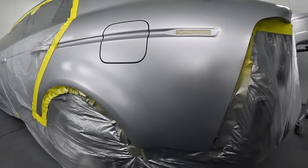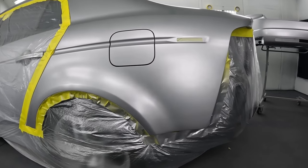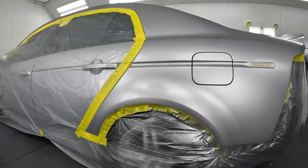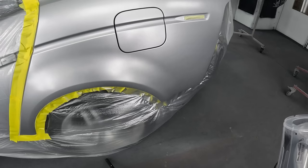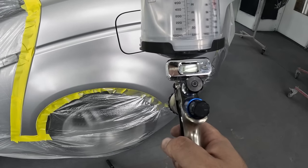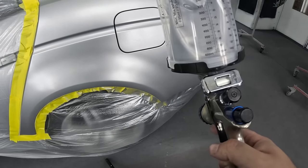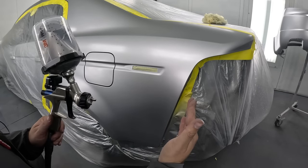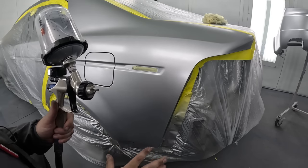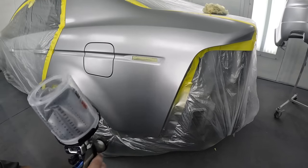Now, looking at the quarter panel after 10 minutes — it looks beautiful. This is only going to need one more coat. Less is more when doing silver metallics. For the last coat, we'll lower the pressure about two pounds — we were at around 13 PSI, so we'll lower it to around 11. On a regular paint gun, you'd be at around 18 to 19 PSI. We're going to increase our distance from about five inches to maybe eight inches and lightly put the paint on. Since we're using extra slow reducer, it's still going to lay very smooth. We'll fan into both blend areas a little bit further.